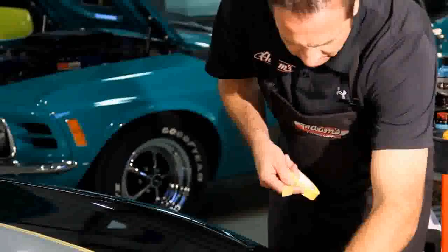So, now the scratches are here. They're all along this front and they're here. So, after I'm done polishing a lot with the drill and the 4-inch pad, I'm going to come back and pull the tape and polish lightly. I just want to make sure that doing the bulk of the scratch removal, I have this little edge taped off. Again, I don't want to see the primer on this car ever.